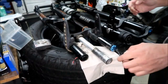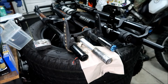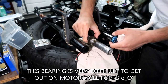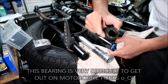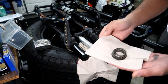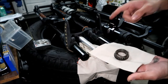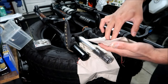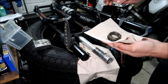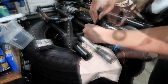Okay, and it makes a big mess - we've got to remove this. The next thing we've got to do is remove this bearing here - and it came out quite easily. It always does. If you were working on a motorcycle fork, it definitely would not be that easy. What I'll probably do is wipe off some of the excess grease on the outside, then repack it with new grease. This is like the second fork I've installed this on and it still seems okay. The race is already still on the bike and I don't see any problems reusing it - I'm not having any problems with the steering.